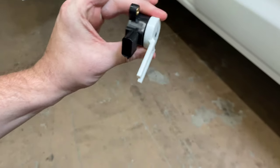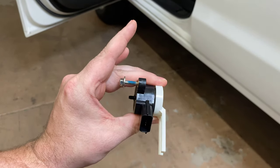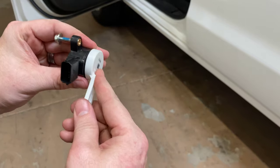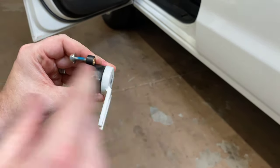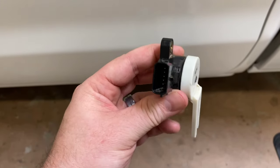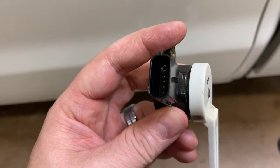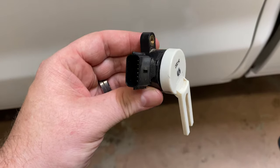We're looking at the sensor here, and this is how it's going to be sitting up under the dash. The bolt that's holding it on will come in from the left side like that, and there's a guide down here that helps hold it on. Pay attention to the general location of that bolt and how it's going in, because you won't be able to see it once we get under there. The small wiring harness will clip onto the sensor — the connector slides over and that clip right there holds it on, so that's where the flathead screwdriver comes into play to help you get it off.